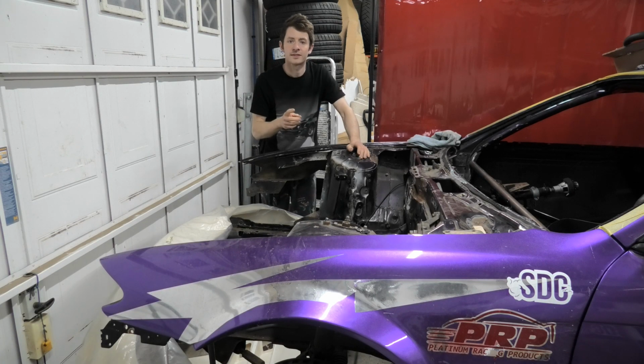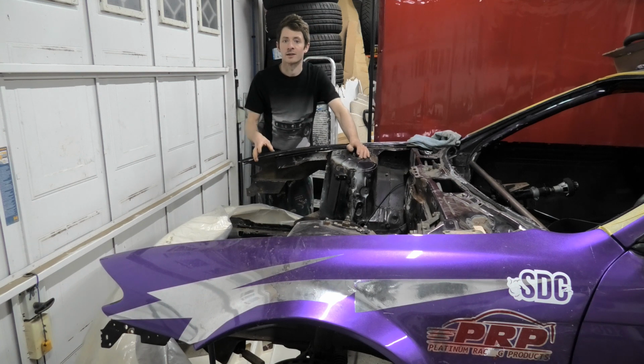One thing I will correct is that when you see me lining up the sump at the bottom of the car, the sump's actually hanging a bit lower. When I took the load off it, the sump was hanging a little bit low, so I have lifted it up a tiny bit. I was a bit worried that the engine was sitting a bit high before I did all this, but I don't see how the engine can sit any lower going by where the gearbox is sitting in relation to the bottom of the chassis legs. So I'm happy with the engine positioning at the moment.